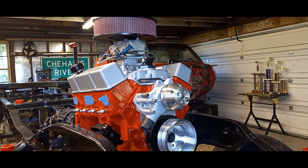When I had first built this engine, it originally had a hydraulic flat-tappet cam in it — a 292 Comp Magnum cam that spec'd out at 501 thousandths lift, 242 degrees duration at 50 thousandths, on a 110-degree lobe separation angle. It made power between 2500 and 6500 RPMs and happily did 7500 RPM. It probably only made about 500 horsepower, maybe a little more. That was still a pretty nice combo, but that just wasn't violent enough for what I was looking for.